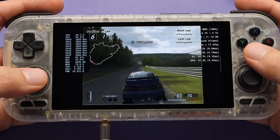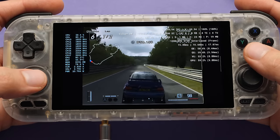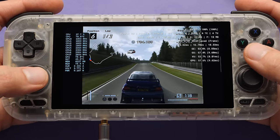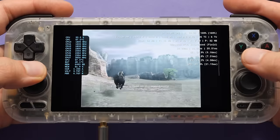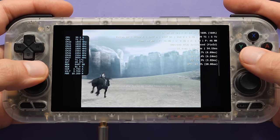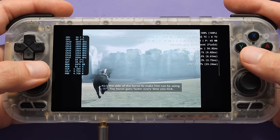Let's go over some of the ways that this issue could have been caused, both from the software side and the hardware side, before we ultimately get to the point where we know that it's a hardware problem and that it's not something that you need to be so worried about. So from the software side, there's really only two ways that this issue could have been caused, and one of them I already detailed with the wallpaper. If we change the wallpaper to white and the screen is still green and all the UI elements are still green, then there must be another reason for that to be the case.